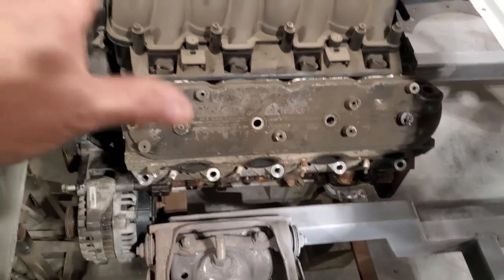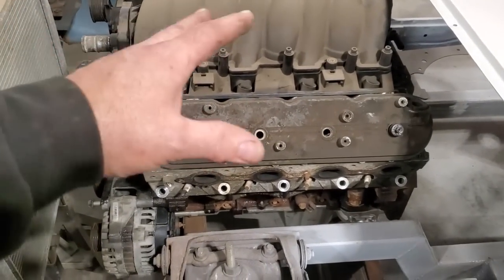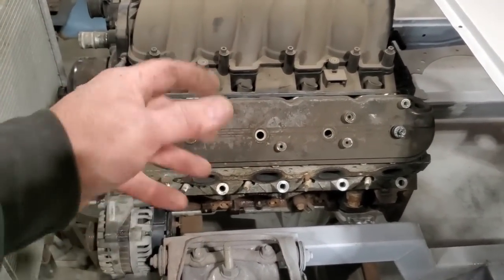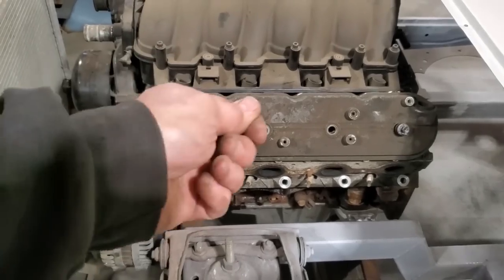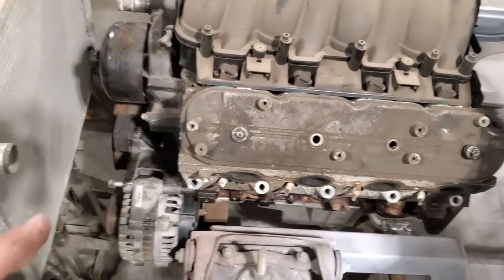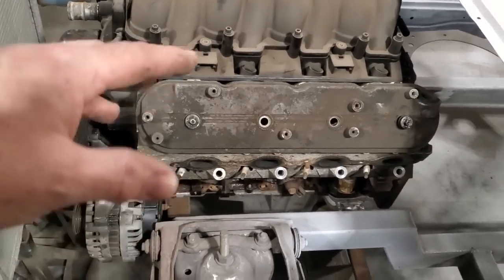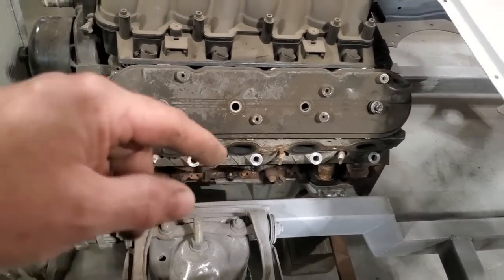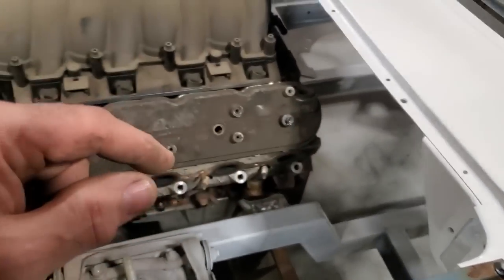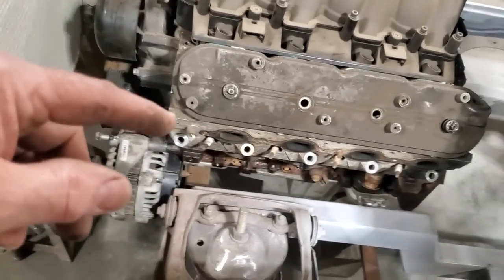So I'm going to build the motor mounts and have it set up so that the motor just falls in there right easy. It lines up very easy. I haven't got to go fooling around and jiggling stuff around trying to put bolts through it. It should just lay in place, slide it back, and bolt it in place. That's the idea I got in my head. It's going to be solid mounted, no rubber mounts, permanently bolted to the frame here and back here as well. The transmission will be on a rubber mount. That'll be another separate cross member.